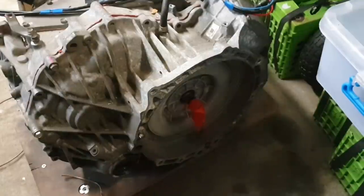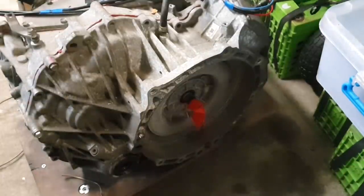So in order to make this easier to see, I put a little bit of tape onto our former input shaft here. I'm now going to come over to the computer. I'm going to set F slip set point to 3 Hz. I'm going to press enter. And I'm going to set amp nom to 10% and press enter. Now, what we see at the minute is that there's nothing happening with our motor, but I can hear a whine coming from our inverter, so that's good.